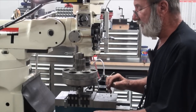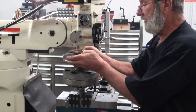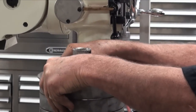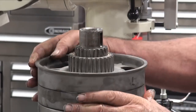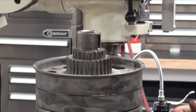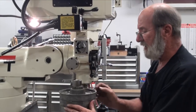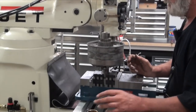We've got to wash all this stuff up so it's going to sound a little gritty, but again this bearing looks pretty good. I drop it in place and I've got no appreciable movement in it. There's a little more clearance here, which is a good thing on any of these bushings in the transmissions — probably because we drive them at a little higher speed so we need a little more clearance. The bronze bushing material has been subject to some discussion about how it's changed over the years, but I'm happy enough with what's here rather than replacing these bushings.